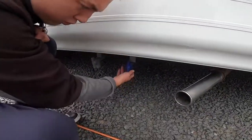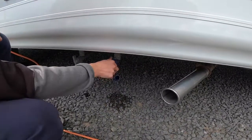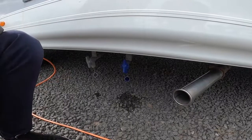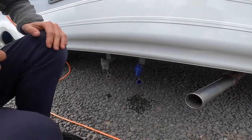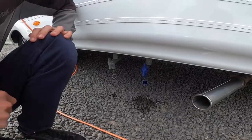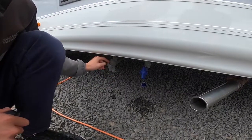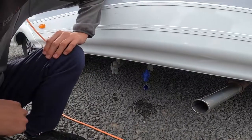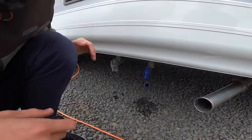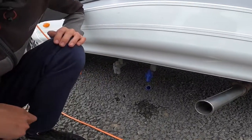To drain your fresh water off there's a blue tap here — take the cover off and empty the water, for example if you've taken on contaminated water. If you're draining down because you weren't using it for a while, or draining fully for winter, make sure this tap is fully drained along with the grey tap, which is water you've used — shower water, dishes water, hand basin water. Open the grey waste disposal point on the way out of your site, as you wouldn't want to travel with dirty water since it takes away payload and uses more diesel. Make sure both are fully drained in winter so no water freezes in the tanks.